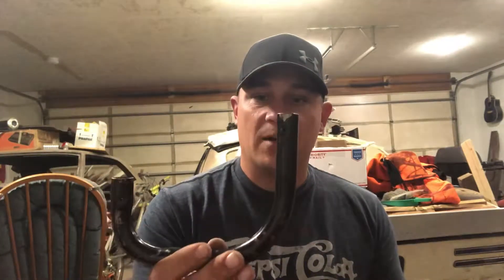Most of the Homelite XLs — even the plastic ones — you can find a metal handle. That's the most common thing. The metal handles also come on the aluminum bodies, and the aluminum bodies are actually lighter than the hard plastic ones, believe it or not. In my opinion they're easier to work with, easier to cut, easier to fix. The plastic wants to start to flex on you, so you have to be careful when cutting — if you're using a die grinder or even a Dremel tool you can melt too much plastic and then you have to fill it in.